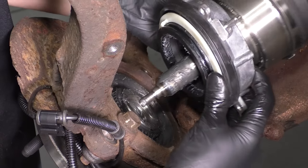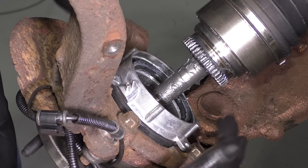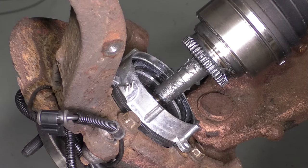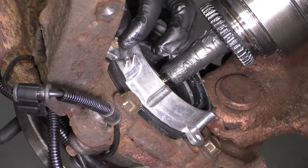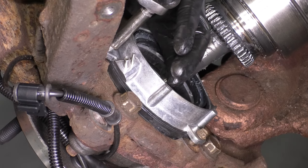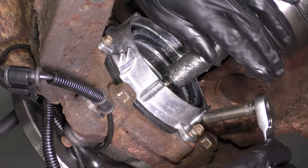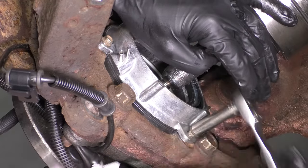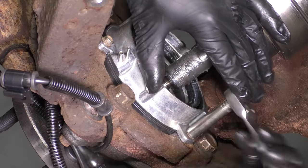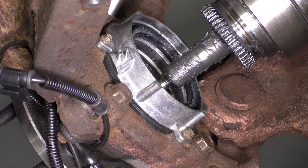Take the vacuum hub, slide it over the axle, aim the axle down, and put the vacuum hub on the knuckle. We'll bolt it on now — the axle doesn't come out with this bolted in, which is why we do it this way. Clamp it down with the three mounting bolts using an 8mm socket. About an eighth of a turn after they bottom out is the most you should go — these are very small, strip easily, and can break easily. You don't want to have to extract them from the knuckle. Double check them all.